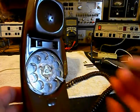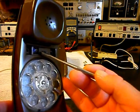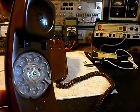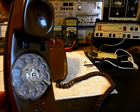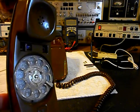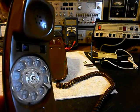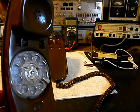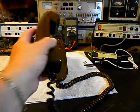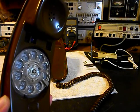Right here is your little light bulb, and when powered with a transformer that will light when you pick the handset up. Now on the princess telephones they would have a switch on them, and the switch would switch the light from being on all the time. When you would switch the switch in the other direction, the other mode would only light when you pick up the telephone. Now on these trim lines they do not have that option because the handset sits down in the base, so they only come on when the handset is picked up.